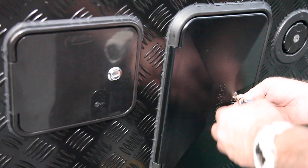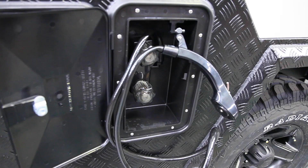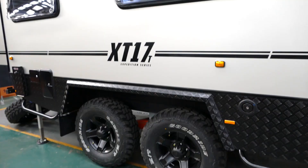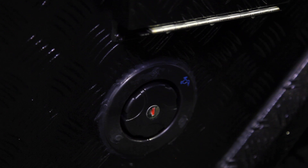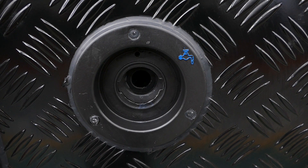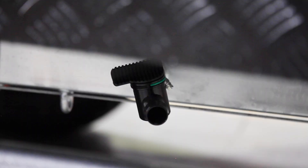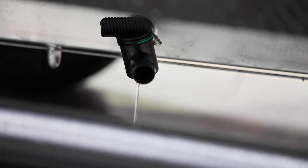The next connection along is your external shower — two nozzles, hot and cold. This is your little valve for water flow. When not in use, hang the shower head up there. Then you've got your grey water point — grey water comes from the shower and the sink inside. You get the key, open it up, and you can flush the grey water tank out. When your grey water tank is full, there's a tap under the rear — open it and dump it.